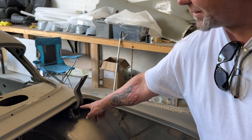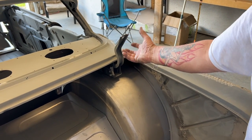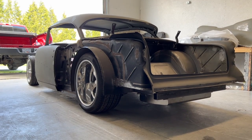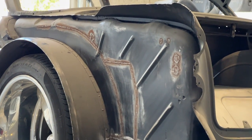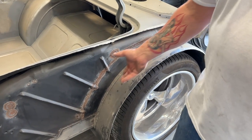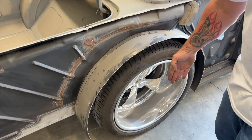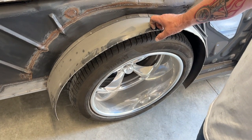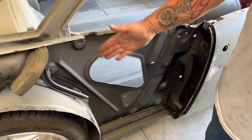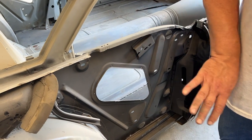This hinge is broken, so there are some repairs up inside that hinge. I was considering taking these hinges completely out and putting billet aluminum shock hinges in there, but it takes some rework and modifying. The quarter panels are off right now so I can clean up all the welding, hammer and dolly everything smooth, do all the seam sealing from inside the quarter panel, and get the undercoating done. This area is going to get a rubber lip that seals to the quarter panel as it comes down. I'm also going to modify this from a crank window to a power window — I need to get my power window assembly working before I put the quarter panel back on.